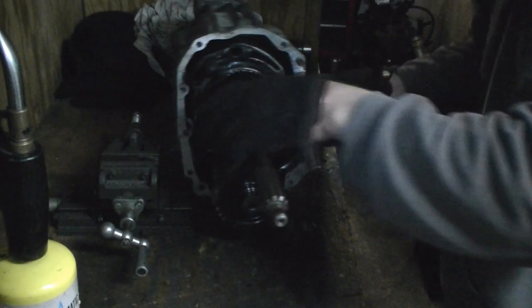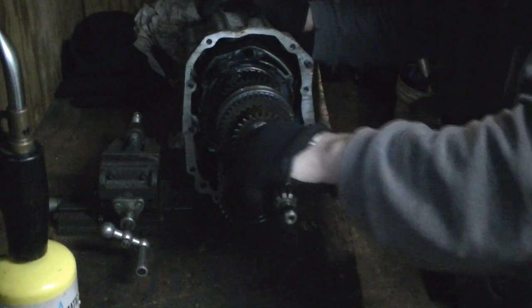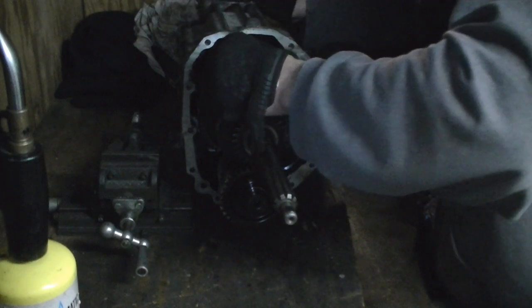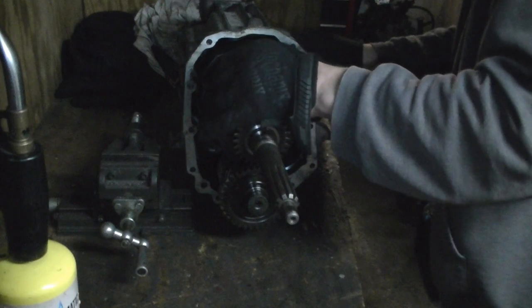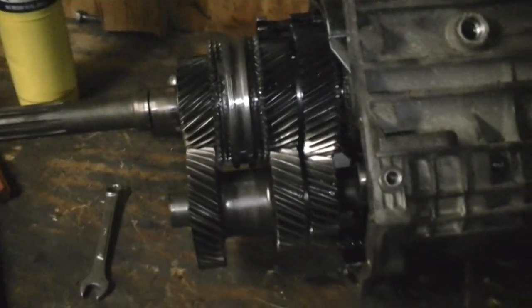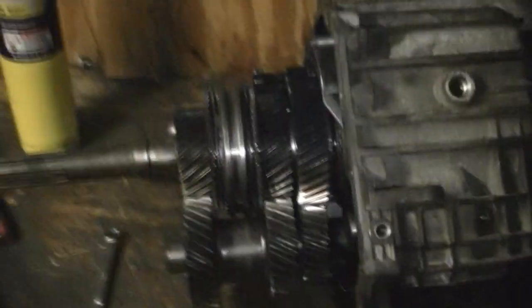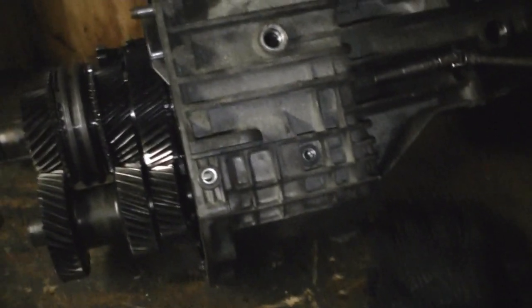This is the whole reason why you need to put this together on a jig. To access the bolts on the sides — they're kind of inside the case — put some heat on them first to warm up the aluminum, then you're going to need a slender socket with a universal joint and ratchet to remove them. There's one on the other side too. The whole gear train has to come out as one assembly, not individually, making these transmissions fairly difficult to rebuild. I'll build a jig for it as I mentioned in my other video for ease of reassembly.